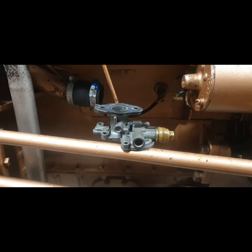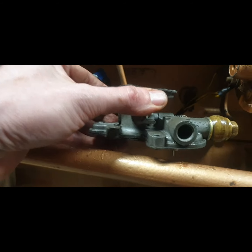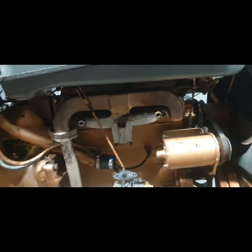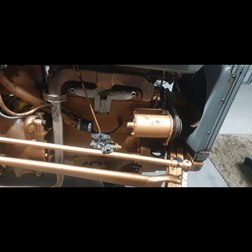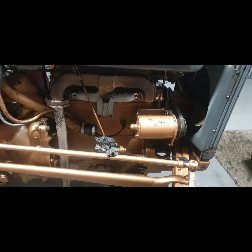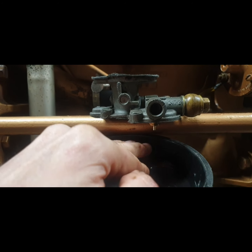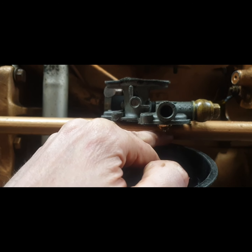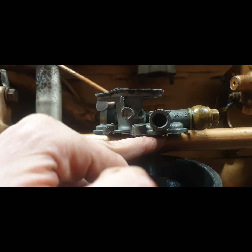I have the top of the carb connected up to the fuel line. I have the new needle valve in and I've put a copper washer behind it to make sure it's the right thickness — measured with the vernier calipers. Both new and old measured 14mm with the needle valve dropped. I turned on the fuel and it does seem to be sealed. I held the needle valve up, gave it a wipe around, and made sure it wasn't leaking — that seems to be fine.